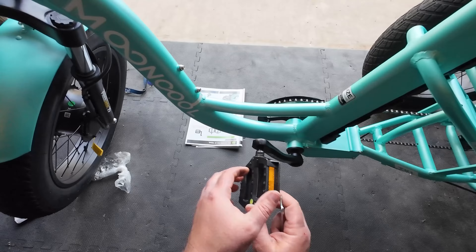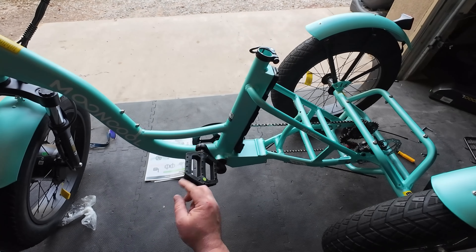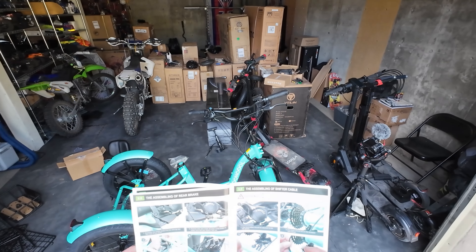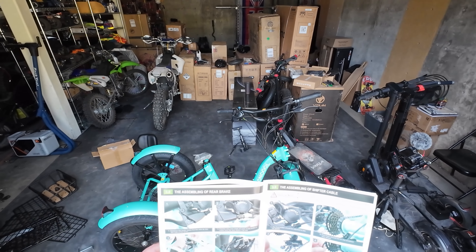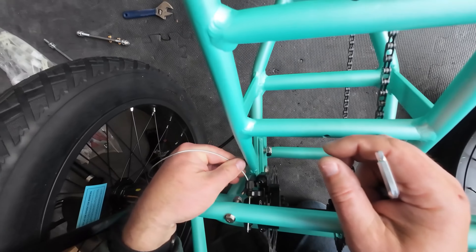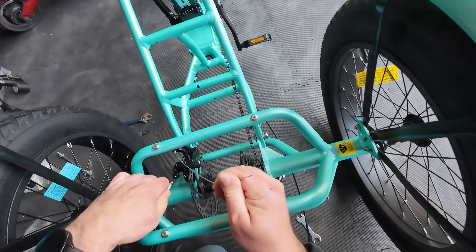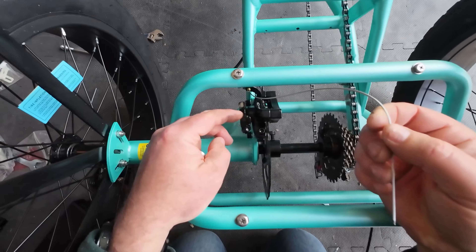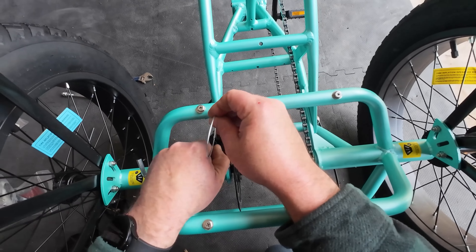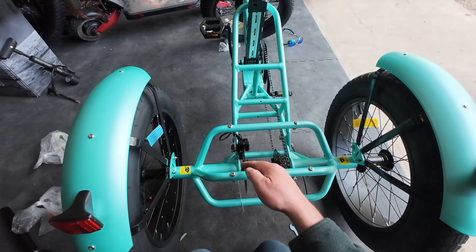Now this is where we're going to hook up all the brake cables, and the shifter mechanism also needs to be attached. We take our allen wrench, loosen up the clamp, and there's a little groove where this wire is going to go in and then come down through the clamp just like that. There's a bunch of wire left over so we're going to need to snip that off. It looks like they could do a little better measuring and planning because this stuff doesn't need to be that long.